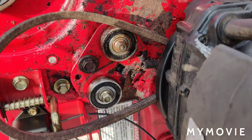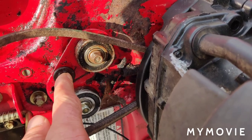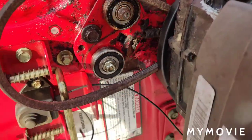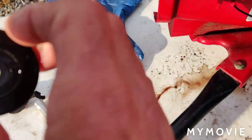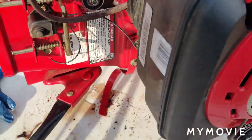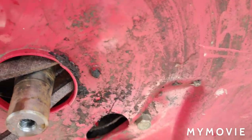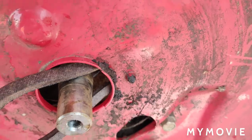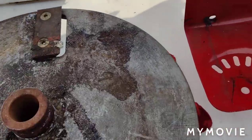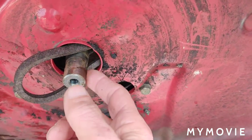What I did was I had to take this whole pulley assembly — there's a bolt right here, I had to take the whole thing off because this is a nut and bolt. And you have to get these belt guides; there are two belt guides on there that you have to take off to route the belt. Then I took the belt and stuck it through the whole housing in here. And what I'm going to have to do is take this impeller and start sliding it onto the shaft.